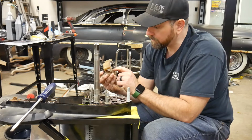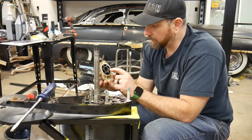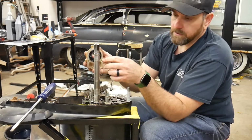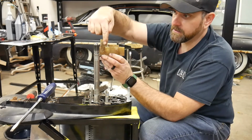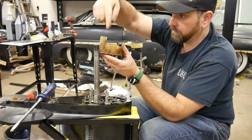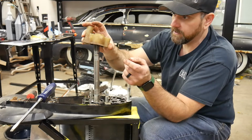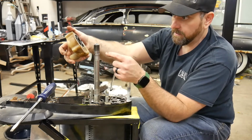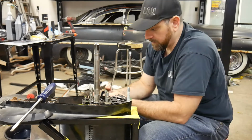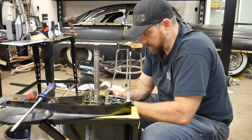I'll show you on the inside. It's not too bad, it's not too cracked, but this is a brass one, so it hasn't been replaced for quite a while. Pay attention when you take this off, but this spins clockwise, and so does your impeller. I'll show you when we're putting this back together, but just remember, this went on like this, right? And take a look at it. The impeller blades are bent this way, which means it spins clockwise, and I'll show you why I say that in a minute. But let's take this out so that you can see.